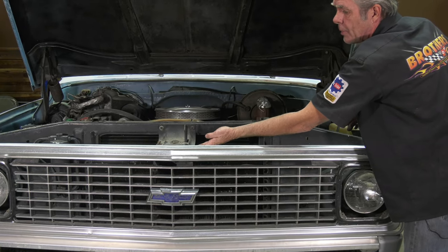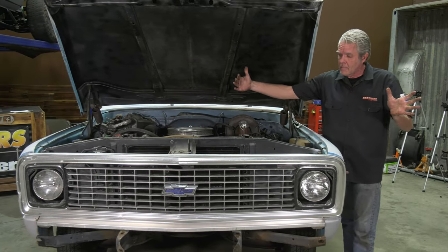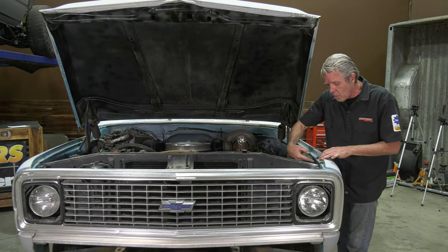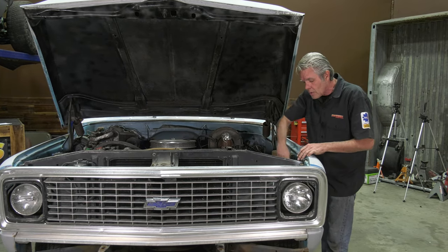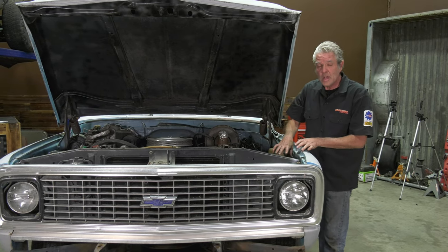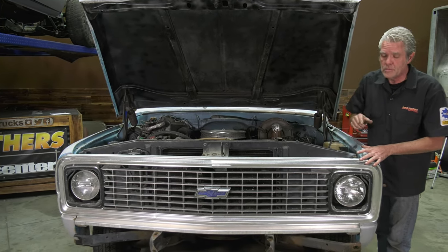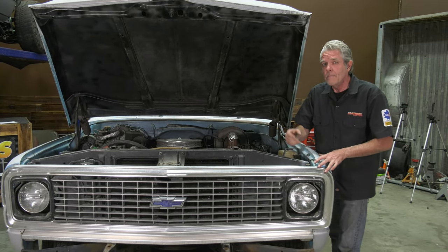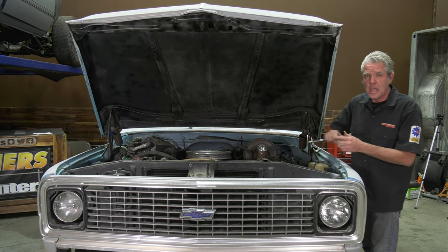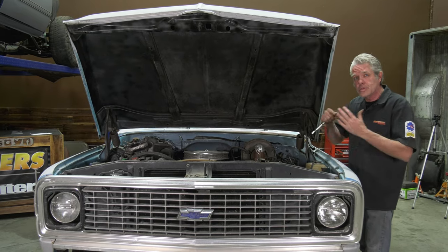The two right here are just loosened up — I don't have to take this bracket off all the way, and of course you'll have the same thing on the other side. Because the truck's been assembled for a long time, the front fenders are all squeezed together and I like to get a little movement in those and bring them back some. I'm going to loosen all my bolts but not take them out, because most of these use cage nuts — welded-in nuts — and I don't want to strip those.